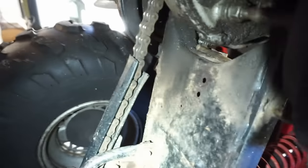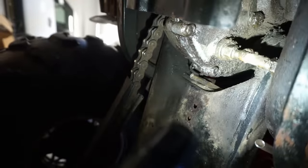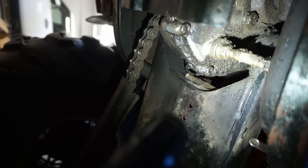See if I can take you guys underneath here with me to check out the drain bolt for this thing. So right underneath here, right there, you can see it right here. So this bolt needs to be cracked open. And what you do is you crack this big one over here first. This nut on here, you back that out this way, and then you actually push this longer bolt in so then you can take out the whole plug. It's kind of a process. So we're gonna try loosen that up and drain that oil out, see what that looks like.